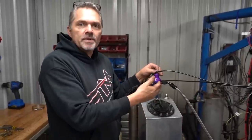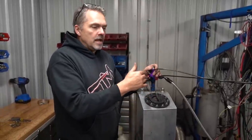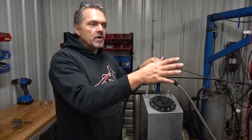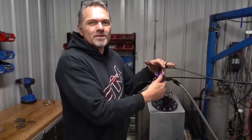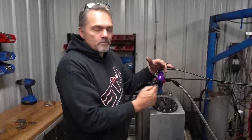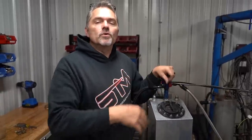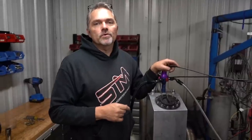Here, it was at 10 PSI, we couldn't get it any lower, so it was just proving out what is going on. So what happens is you'd set your fuel pressure if you could get it low enough, but going down track, when it took all the fuel, it actually went to its correct fuel pressure, what it really was, not being all backed up inside there. All of a sudden you burn up an engine because your fuel pressure is too low and it runs out of fuel. Tech note for any of the blow through carburetor guys.